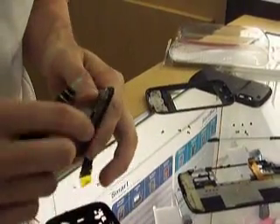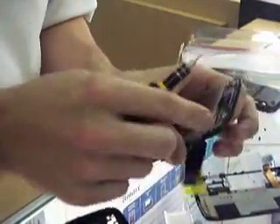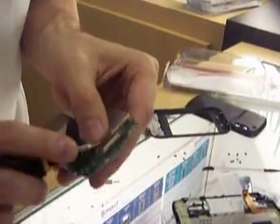You're going to lift that up. Your flex cable actually connects through here, and there's a long flex that goes all the way around here. There's just a little bit of adhesive on the other side — just lift up on this side and the entire flex cable assembly will come out. Now we've actually removed the LCD from the housing. At the very bottom we have a hinge — lift that up and we separate out the LCD. That is typically the part that breaks.